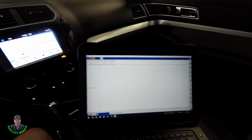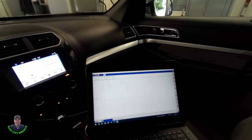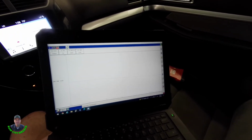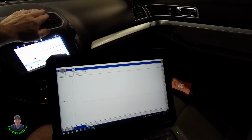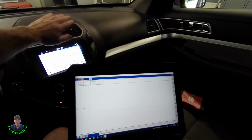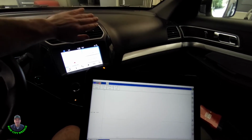Okay, I just turned the AC on. It says AC clutch engaged, AC request yes. Evap temperature 73.4 still. There it's dropping. Hopefully you can see this. Get it in real close. There, the air is starting to get cooler. That's 53. Still AC clutch is engaged. Request yes. Evap temp at 48 now. Yeah, this thing's getting cool fast.